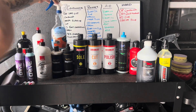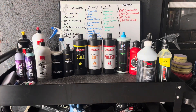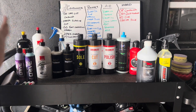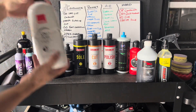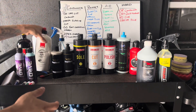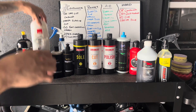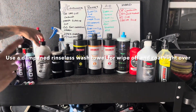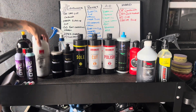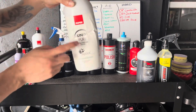It feels like they added more oils to the formulation and it just doesn't finish or cut the way you want as a polish. Next is Griot's Garage Correcting Cream — I don't have it on the table but it's inside. It's great for one-step jobs; it does just a little correction in my opinion based on my application, but you do have to tape off plastic trim. After that, Rupes Uno Pure — I've used this a bunch as an ultra finishing one-step for finicky paints before coating. You can literally coat right over this; I've never had an issue.